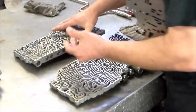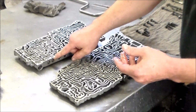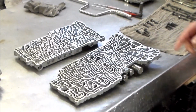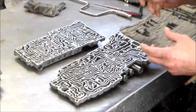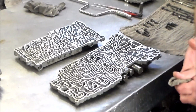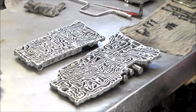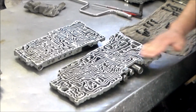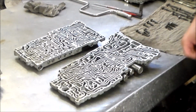And I had a couple of the valve stoppers for the end plugs that had fallen out, but I found out where they went. One of the things that I did before I did anything was snap a picture of the valve body with my cell phone, and then I had one fall out, which was this one right here, and I really wasn't sure where it went, so I started looking real up close, made the picture big in the phone, and found out where it went. And the other one was just one of these that had fallen out, so that was no problem.